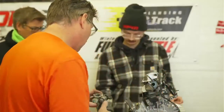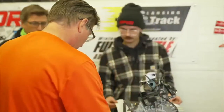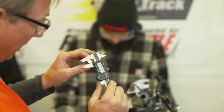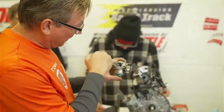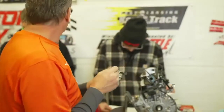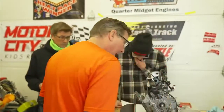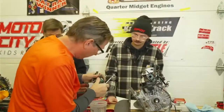This is important because if it went in at the track, that's a DQ. The no-go gauge should be 0.429. The go side is 0.4295 — so they're giving you half a thousandth on that tool. If you've messed with that venturi opening, you're busted because the gauge will slip right in and you're DQ'd. That's a really easy tech item — you don't even have to take the carburetor off the engine to do it.